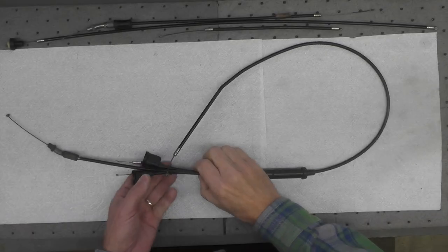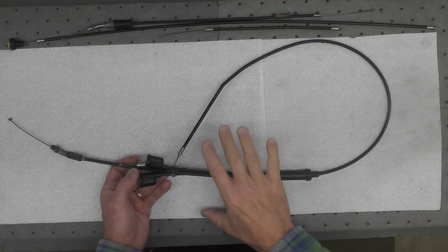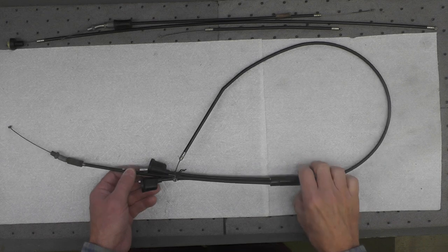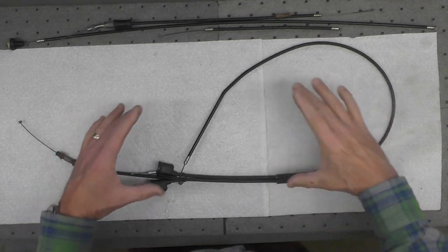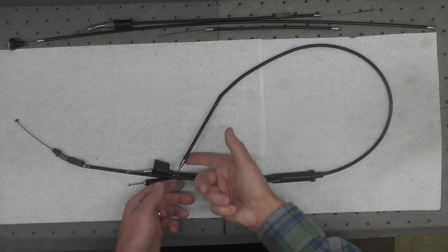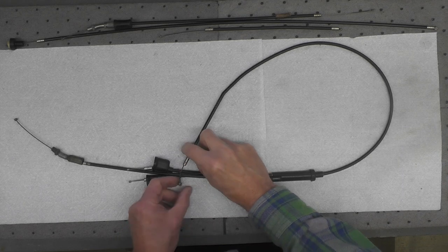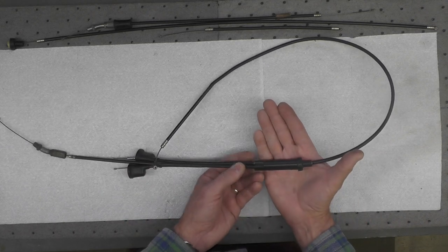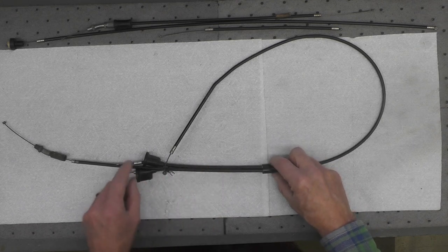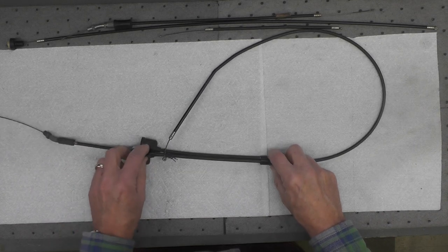But first we need to do a little maintenance to prepare the throttle cable for use. We are going to work on cleaning up the throttle cable assembly and I am going to replace some of these cables. This is the original throttle cable assembly that I pulled off the bike when I broke it down. This end of the cable goes up to the throttle grip assembly, and when you twist the throttle grip it will pull on this end. It comes down to this junction block where it splits into three — the longer one goes to the oil pump, and the two shorter ones go to the carburetors.